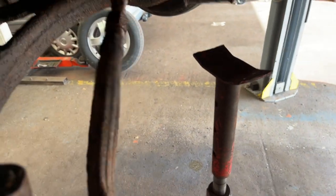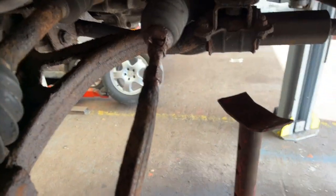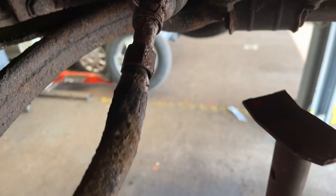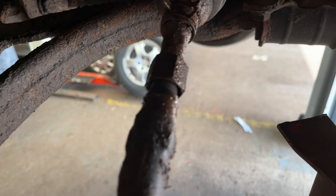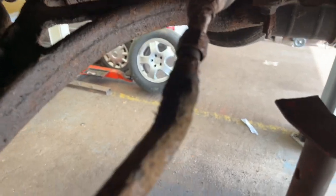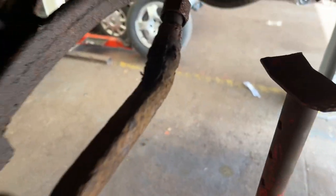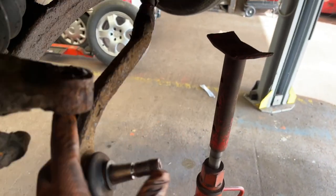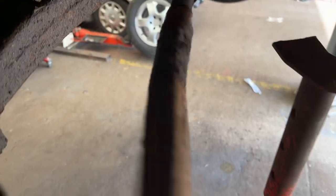Normally I'd count the number of turns off, but since it's going in for four-wheel alignment on Monday, I'm just going to wind it off. You should count the turns so when it's done and four-wheel alignment is booked, you're not a million miles off. If you count your turns — say it's 20 or 15 — and put it back on the same amount, I tend to find you're actually not far off. But it always needs checked regardless.